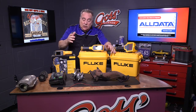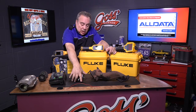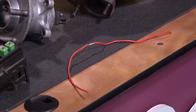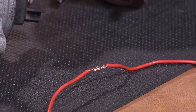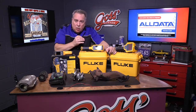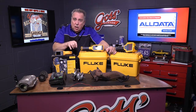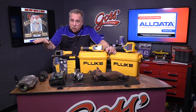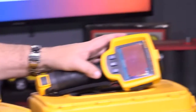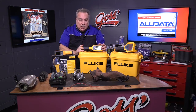We can also look at wire connectors or splices, such as a twist splice that may have some corrosion on it causing resistance and something not working right. We aim the thermal imager at it and we can see if that connection is good — it will either be cool and normal, or overly hot. If it's overly hot, it shows up as red on the imager, and that tells us we have a problem.